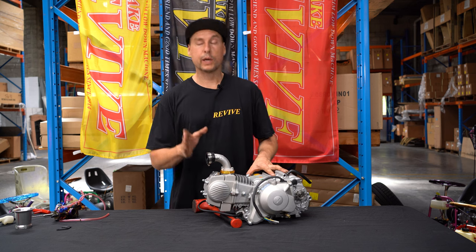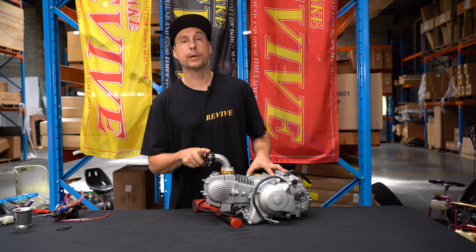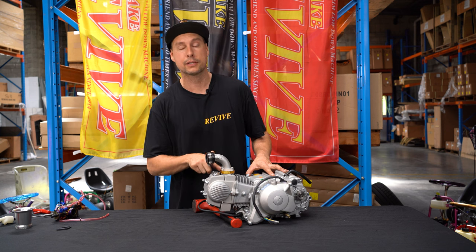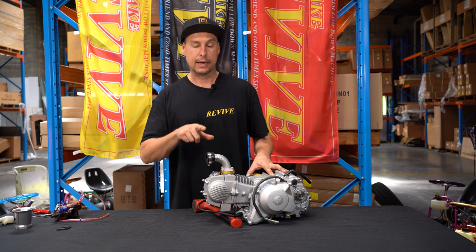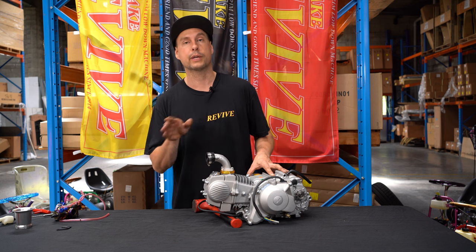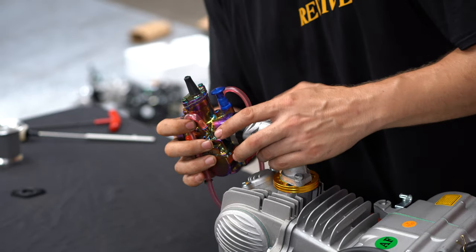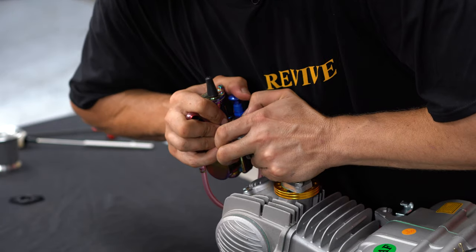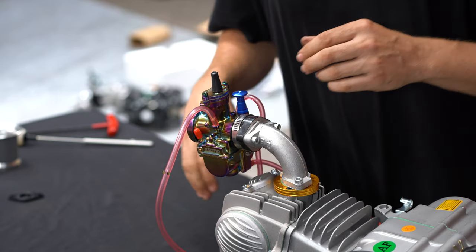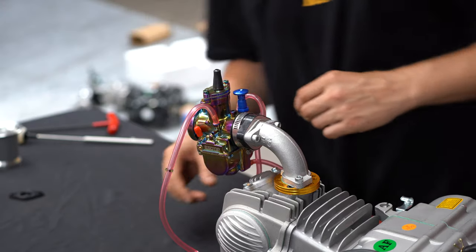It's worth noting when I fitted this carburettor adapter to go from our carburettor to our intake manifold, I haven't used the gasket or any liquid gasket maker, as this adapter had an O-ring on the rear of it, so therefore no gasket was needed. I'm going to take our carburettor and insert it. Make sure it's vertical, level, straight. Which it is,